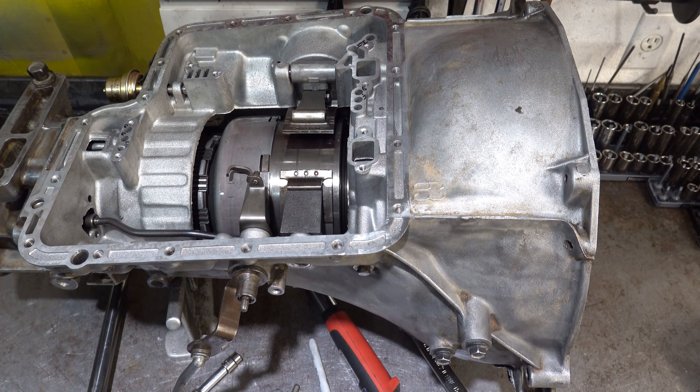The tools you'll need for this job are as follows: you're going to need a torque wrench capable of at least 40 foot-pounds of torque, and one capable of producing 10 foot-pounds of torque. I don't have one wrench that does both, so I have two different torque wrenches. You're also going to want a regular 3/8 inch ratchet that will allow you to back the adjustment screw off.